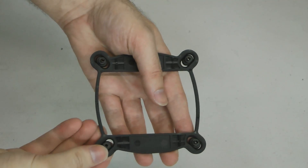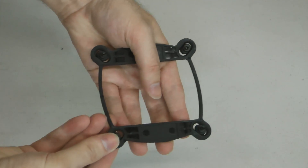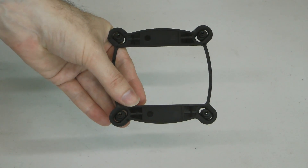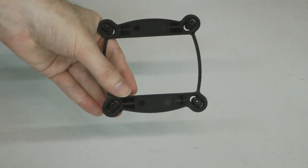For this video, we'll be installing the H105's back plate and block onto the most common platform currently available, Intel's LGA1150. Note that this is also compatible with LGA1155 and LGA1156, which both use the same mounting hole spacing as LGA1150.